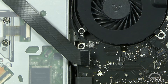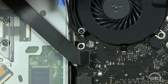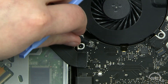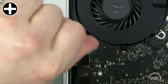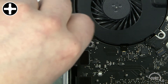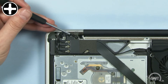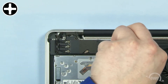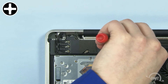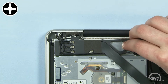We'll need to remove three screws to extract the optical drive. The first screw is located here — gently detach this cable, then remove the screw. To get at the second screw, we'll need to loosen this module first by removing this long Phillips screw and this shorter one. Once you've done that, gently pull the module back to reveal the second optical drive screw, which can then be removed.